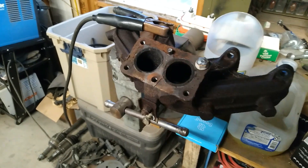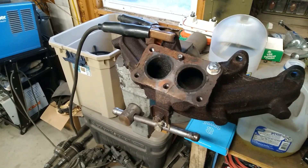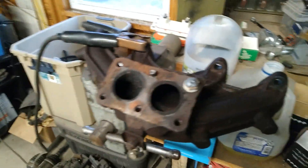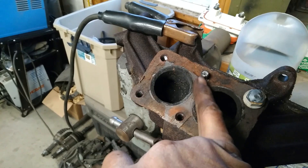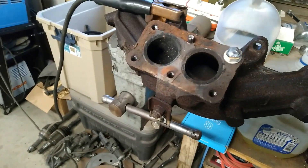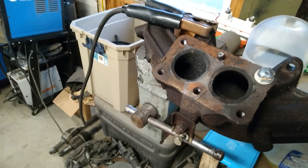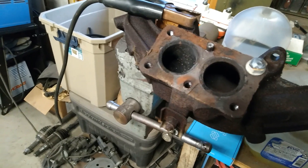So taking the cylinder head off of this Volkswagen, I took the exhaust manifold off and to free it from the exhaust pipe — the header pipe — I had to take the studs off on the exhaust flange. There are six of them and I managed to get two out in the traditional way of putting a socket on the bolt and taking it out. The other ones got stuck — the stud just broke off inside the nut. A cool way of undoing stuff like this, if you've got some stud sticking out: if it breaks off flush, you've got a different thing — you've got to drill it to center and then get a screw extractor, or keep drilling it out to the tap size of the hole and try to re-tap the hole and save the existing threads.